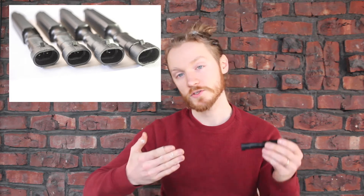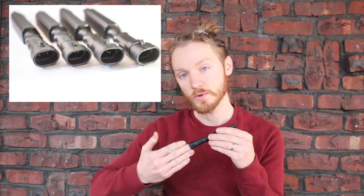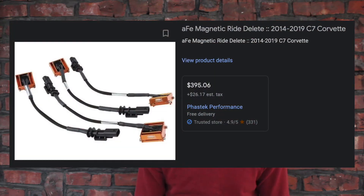The easiest way to get by this problem is to install magnetic shock bypass units. These bypass the original connection and complete the circuit from the computer to the shock, telling the computer it doesn't have to worry about that circuit anymore. There are several options out there. However, these particular units are 100% plug-and-play because they have the original GM factory clip installed on them. In most cases, there's no need for soldering or crimping, so it makes the installation super easy. You can get a set of four of these on Amazon pretty cheap. The connector is generally the same, but depending on the year of your GM vehicle, it's super important that you choose the correct bypass. These units use the same GM OEM clip into the magnetic shock, and they're a much more affordable option than others out there online.